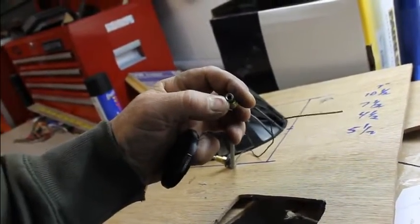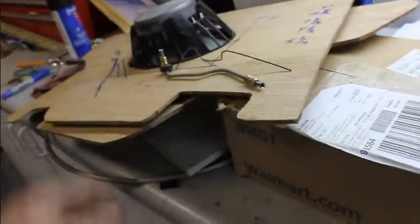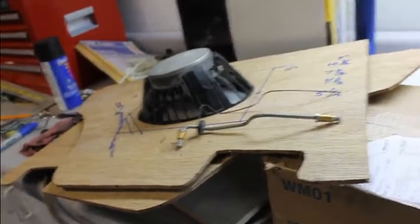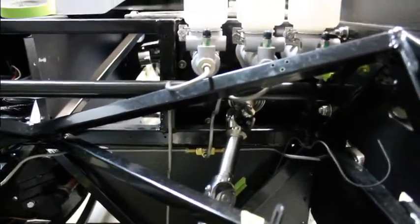This is a Cornwall kit. These are kind of hard to make a nice flare with — it's got to be centered and the angles have to be even all the way around. I have to babysit that thing when I use it, make sure it's getting compressed equal all the way around. Clean out the inside edges. But there's the first line — I'll get that put in and get the other side done.